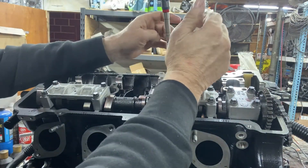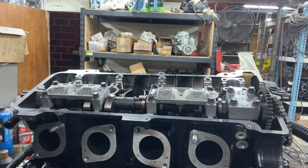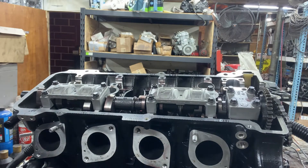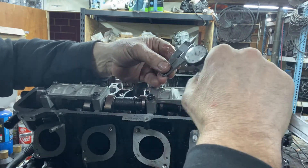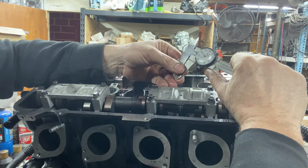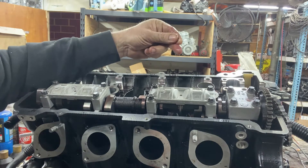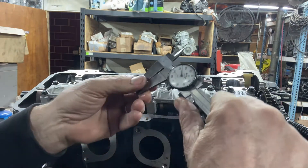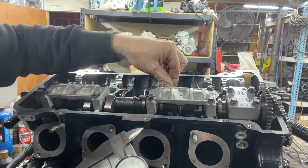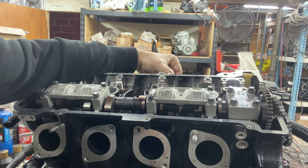This one says 182 on it, so that was easy to read. The new ones I got, you can't read them. I don't know too much about these Hot Cams ones. So that one is reading 71 thousandths. I want to increase the clearance, and I basically just need to go up 3 or 4 thousandths to be in range. So this one is reading 74. That should do it - let me think about this, because I've got 8 thousandths clearance.